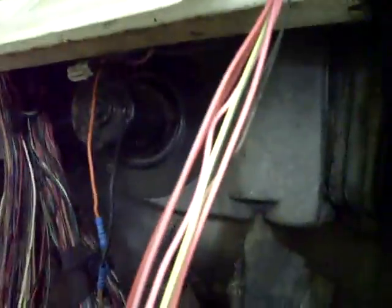Let me show you one last thing. Here is where the evaporator is at — the one we've added in from the Crown Vic. We've mounted it right here at the kick panel. There was a vent control valve that those of you familiar with this era of Ford pickups will know — you can open and close right here. We removed that and put this evaporator in its place. Once we get all this sealed off, the cool air will just go right in here where the original heating system is on the 67 model.